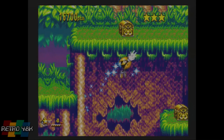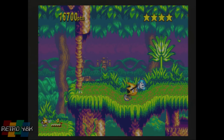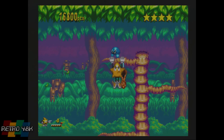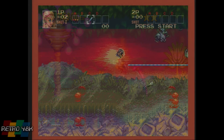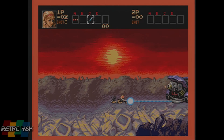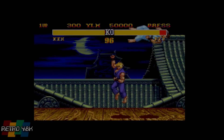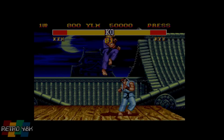There were also some colour limitations on sprites in terms of those four sets of 16 colours discussed earlier. That brings me to the end of how the graphics worked. I don't tend to go into sound too much on these videos, and with the Mega Drive the Yamaha sound chip and Z80 processor are so iconic I don't feel I could do them justice briefly. The Mega Drive used FM synthesis — it generated sound on the fly rather than playing samples — so it took real skill to get a lot out of it, and it gave the console that awesome rock sound. Potentially in the future I may do a dedicated video on Mega Drive sound.